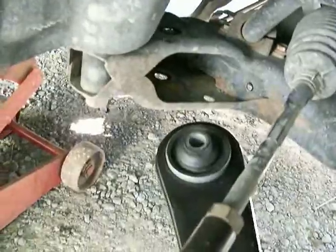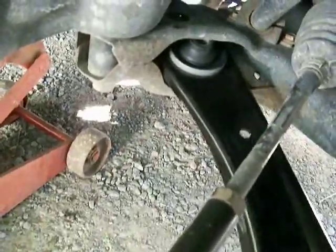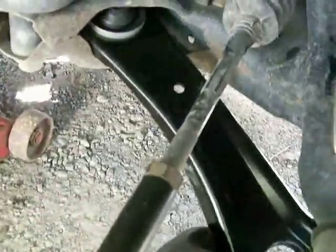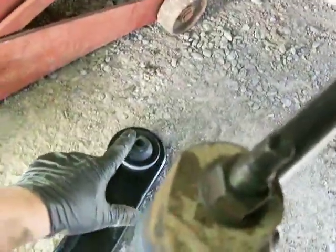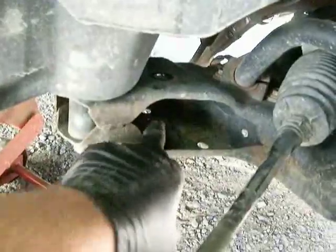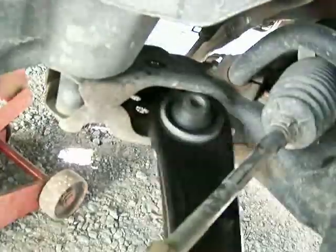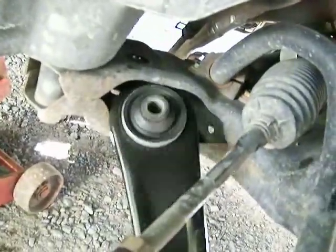For reinstallation, put this end up first — it might be a little harder going back in, you'll need two hands. Sometimes you've got to use a hammer, and I've even ground that down once in a while so it slides between the two. I'll put the camera down, hammer it back into place, and then pivot this back into place. Put the bottom back bolt in first.